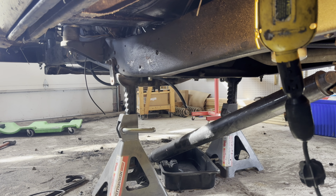So yeah. Now the instructions said to go ahead and wire wheel everything so the bracket will sit flush with the frame. So I already have the wire wheel on. I do need to do a little bit of grinding down here on an old weld. And then there's a little spot over here I need to grind as well. So let's go ahead and start cleaning it up.